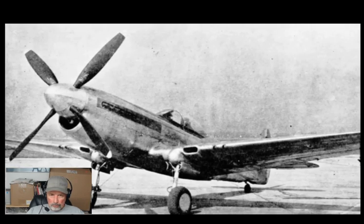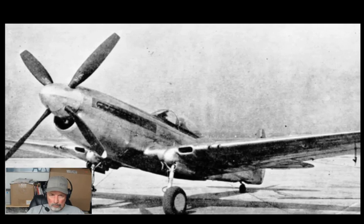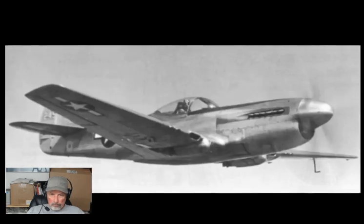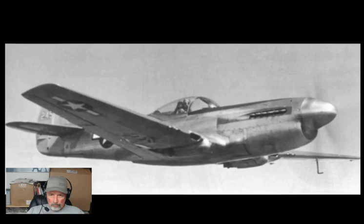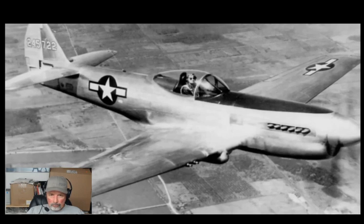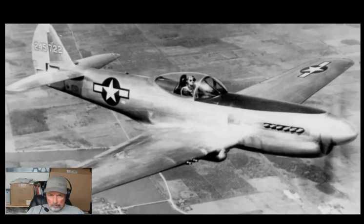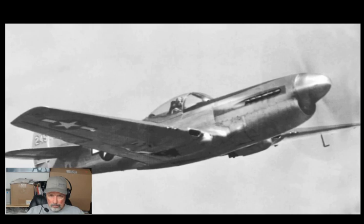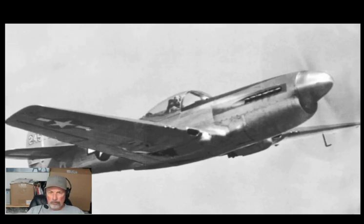The clip wings, along with the bubble canopy, gave the aircraft a rather P-51-ish look, though it's important to note that the wings on the P-40Q were the original P-40 thickness and not laminar types as used on the Mustang. Further changes between the Q-2 and the 2A were the addition of automatic cooling shutters for the inner wing intakes. Flight testing showed performance to be broadly comparable to the Q-2, but the Allison engine proved extremely problematic, and the Q-2A spent a great amount of time being repaired instead of undergoing testing.